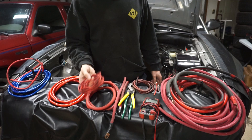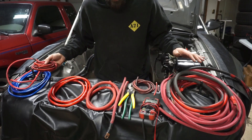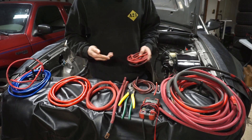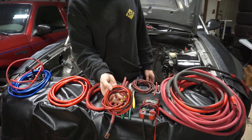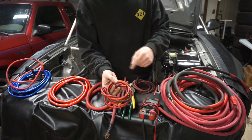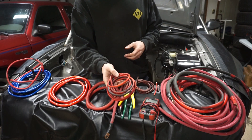A lot of you guys probably know this stuff already, especially if you're into car audio, and that's why I have a lot of car audio wiring. So a lot of my OG subscribers are really going to like this video — they used to do a lot of car audio stuff back in the day. So this is what's called a copper clad aluminum wire. Basically it's an aluminum wire with a copper coating on all of the strands. This is a really light wire compared to OFC copper.